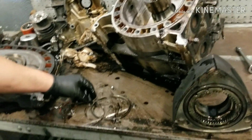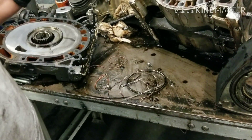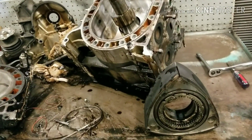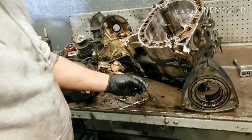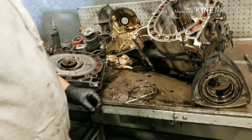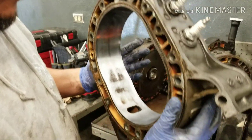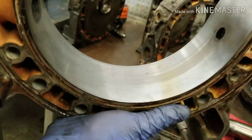These things are all worn down, so I'm gonna have to replace these. Hopefully when I take apart the back one right now, the rotor's still good and everything. Right now I'm gonna keep count of everything — make sure I have six of these, six of everything pretty much. Got one — this one's really good, it has a little bit of edge wear, but all that could be resurfaced out.